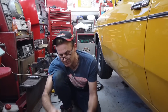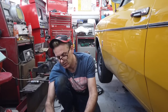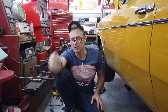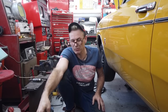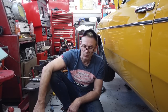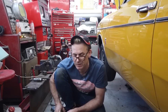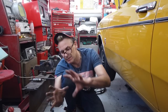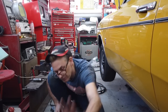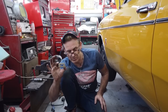So, we had to make this axle adjustable, and to lock it in place, we used serrated plates. We're going to weld them onto there. And that's how an original Mark III axle would have the setup. Why they became fixed later, I don't know. So the question being, how come later Cortina axles weren't adjustable, I do not know. But the early ones were, certainly on Js, Ks, and maybe early Ls, you had these serrated plates enabling you to twist the nose of your diff casing where you needed it to be to match your prop shaft and gearbox angles.